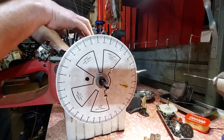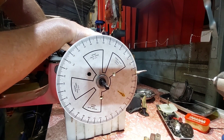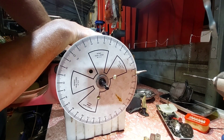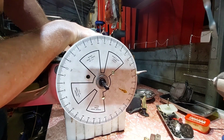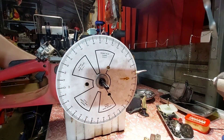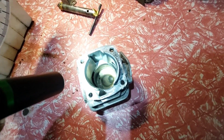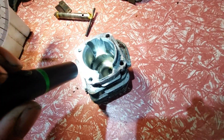So I'll roll this over - I know they are normally 125 degrees. See what she is. We'll line up the 125 mark, back off the 180, have a look. Yep - the 125. I'll show you that. There's a ring - you can get it on 125. I'm happy with that. Make sure both sides are the same.